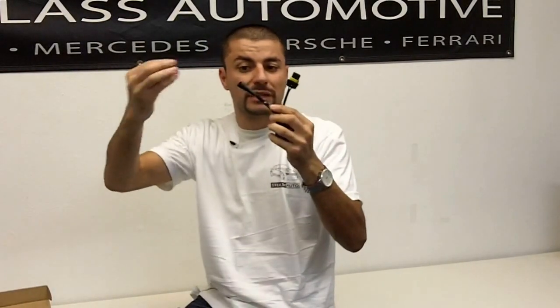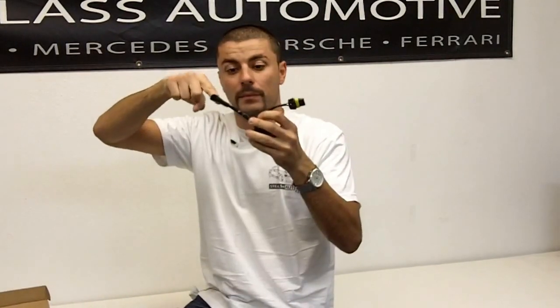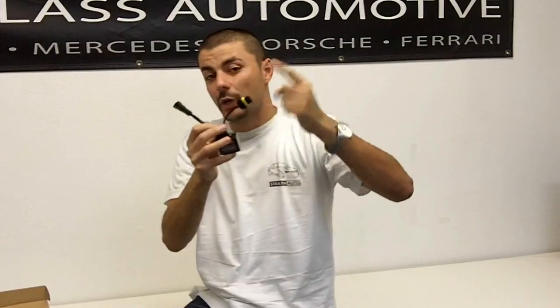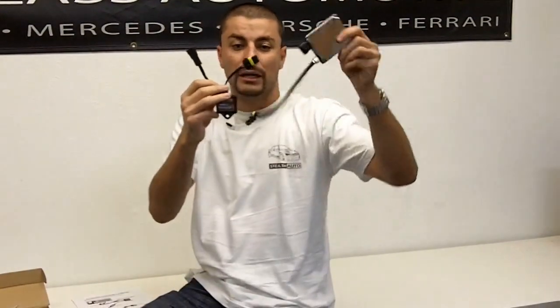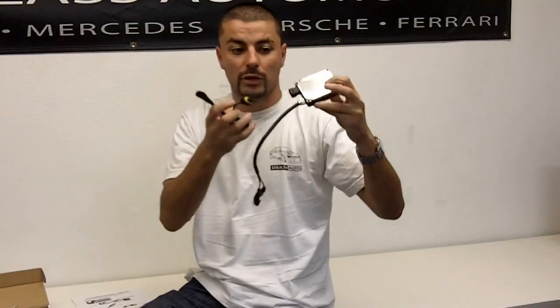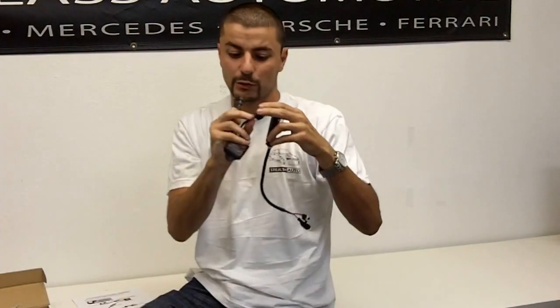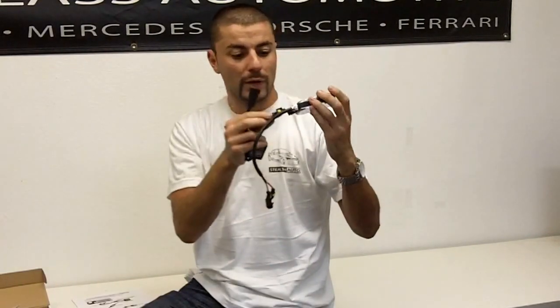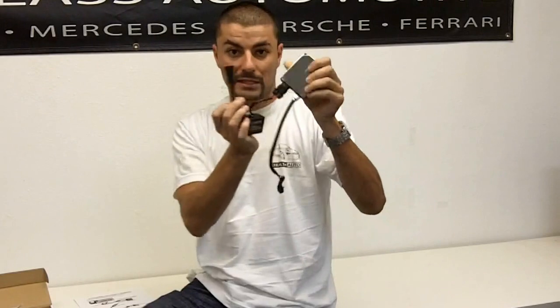From your vehicle's wiring harness — the wiring harness from your vehicle is going to go into the female end. So this is your input. The male end is your output. The output has to go into the ballast you have. So you want to make sure that you look on the ballast — there's a plus and a minus. I can see red here and black, so the red is going to match up with the plus. You clip this on — this is done from this side.